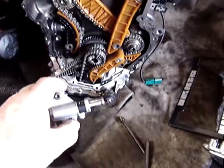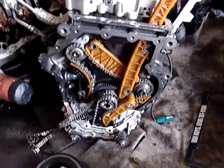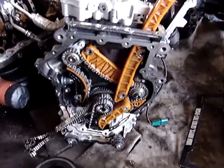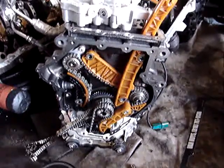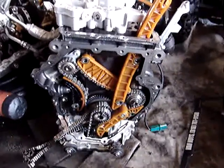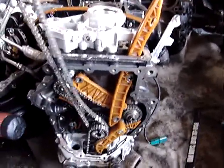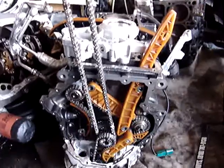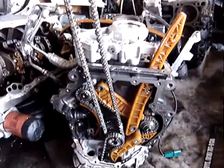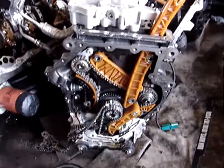This is what it looks like. The most important thing in this job is to mark your timing chain so you do not lose its position. This is a very complicated timing chain setup — there are three timing chains on this engine. The most important one is the one that goes to the cam. Mark those timing chains in relation to the cam sprockets; they must go back exactly where they came off, on top dead center.